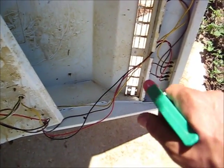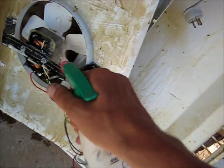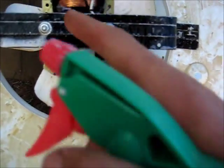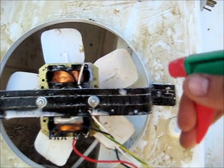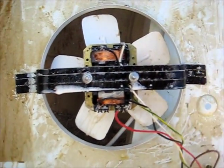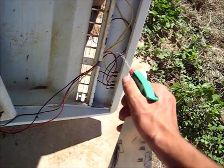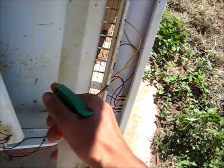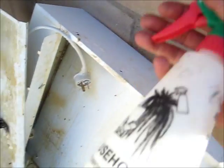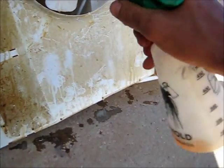Look at that - you can see how grimy my hands are from just working on it. It's just sticky and messy. I'll wash the cord. The degreaser will soak into the windings, but I'll wash it out with some contact cleaner, press air in there and blow it out, then just sit it in the sun for a couple of days. It should fire up again. The windings are coated in insulation, so there's nothing the degreaser is going to wreck. It's peeling everything off - this stuff's fantastic. I've had a big industrial commercial dishwasher like the restaurants use and I reckon you could just stick it in there as-is to clean it. I bet no one's done that with a range hood before.